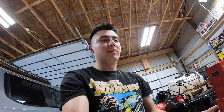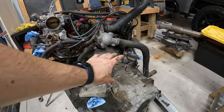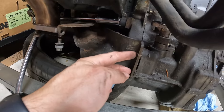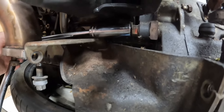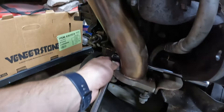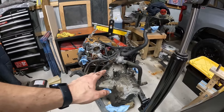Once you crack all those loose you pretty much just get a pry bar in there and separate the casings. All the bolts on the front side are pretty easy and accessible. There's a bracket that goes into the transmission with two 14 mil bolts, and then there's also one right here - another 17 millimeter. The way to get to this is to go behind your pipe that goes to your down pipe, right over the top of this other mount, and you can get a socket back in there with an extension.